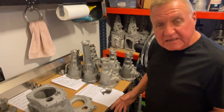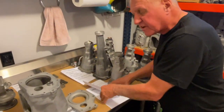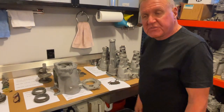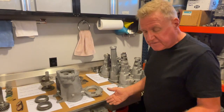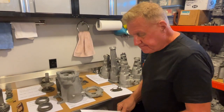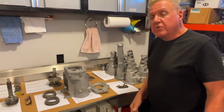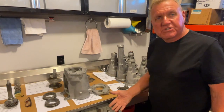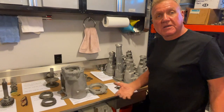I just got through building this 1968 M22. Until 1970, only M22s had drain plugs — '69 and earlier, only the M22s had them, nothing else. After 1970, all transmissions had drain plugs through 1974. The 1970 Chevelle with the LS6 engine got what I call a 1971 M22 — it had the bigger tail housing, bigger output shaft, bigger bushings. That was only for the '70 Chevelle. Corvettes with 454s did not get the bigger tail housing and bigger output shaft until '71.